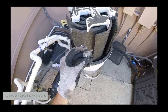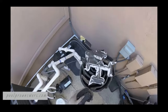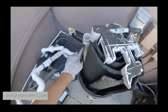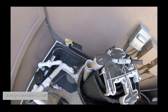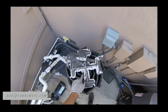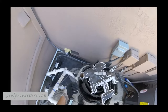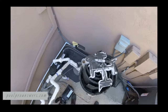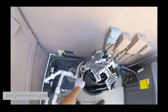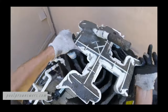Some of the white stuff is the DE. The black stuff is everything the filter has picked up. So what we're gonna do is pull this thing out and go wash it off. Something to watch for when you're pulling this off: make sure you have an O-ring here — that's a common thing that gets lost when you take the manifold off. Another mistake people make is they start unscrewing pieces thinking the whole thing will fall apart. I like to pull the whole thing out as one complete unit. Just make sure you don't lose that O-ring, because if you do, stuff's gonna get by the filter and you'll have a dirty pool. Pull everything all together, straight out and down.